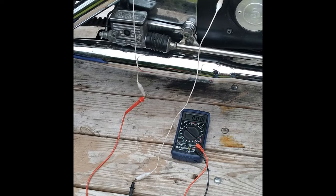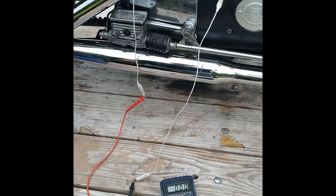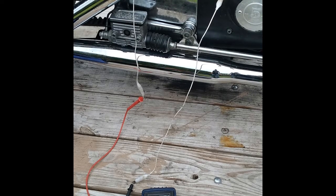So we're there. Key on — it's at zero volts like it should be. Click. Oh, we got a little bit more today — 0.5 volts, almost 0.6. Still not enough, really. That thing should have 12 volts going right through it to the starter — at least 12, or 13. So we're getting basically a 12-volt voltage drop through the solenoid.